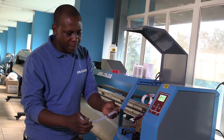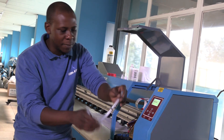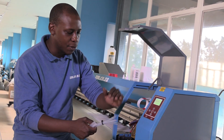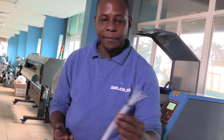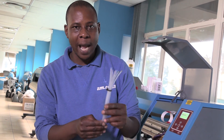The reason for folding the pipes is that you'll notice the pipes still have a little bit of liquid inside. When you fold the pipes, it allows you to pull them out from the head without whatever remainder of solution dripping onto the printer. For those that do not have the pipes, you can order a meter of eight lines on buythis.co.za, which is our online store for am.co.za.